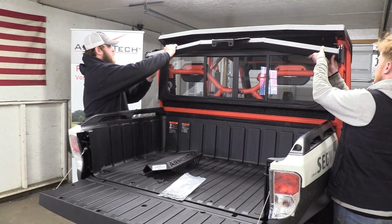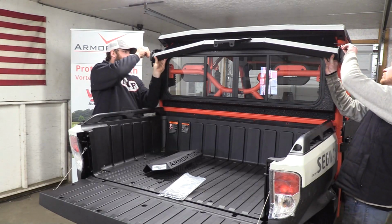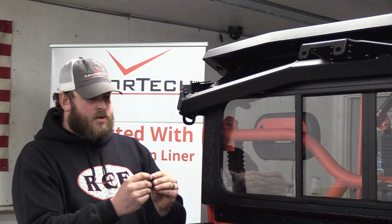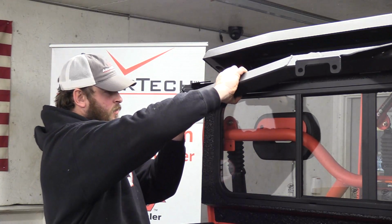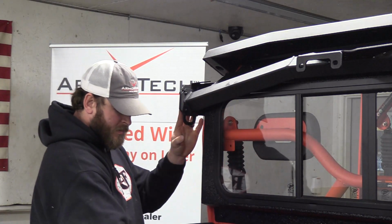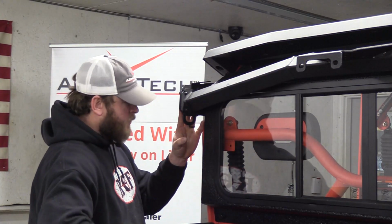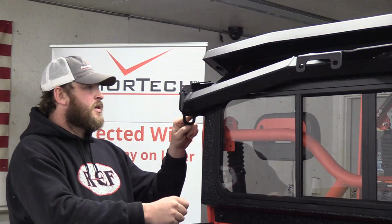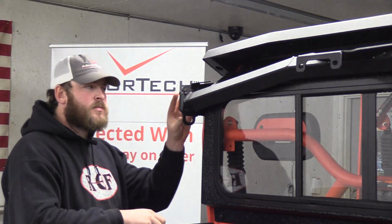Roll it up. Okay, we'll slide a 3/8 flat washer onto the bolt. We'll go ahead and stick that into the hole. All right, we'll back that with a 3/8 flat washer, 3/8 lock washer, and a 3/8 nut. And we'll do this for all 4 holes on the flange. We'll start these loosely and then we'll move to the other side.